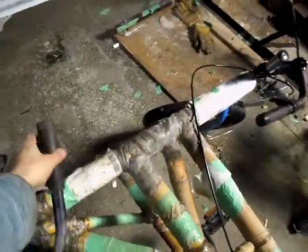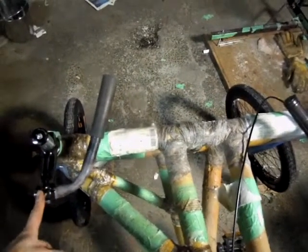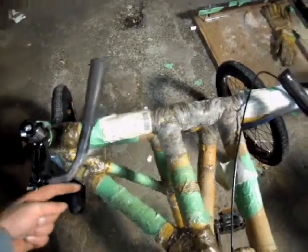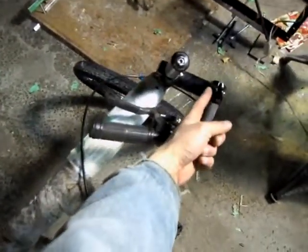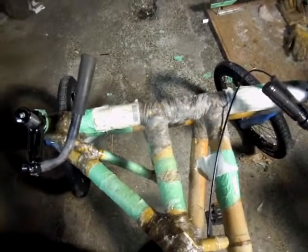Right now I'm not sure whether or not to connect the two front wheels with any kind of tie rod. I was thinking of just taking a spherical bearing — a heim joint — and running it from here to here, so that these two wheels would be locked together instead of independent. But if they're connected straight together, there's something called Ackermann steering, which this would not have.